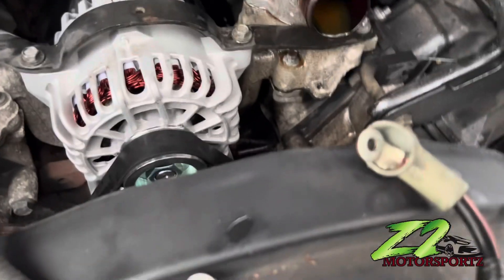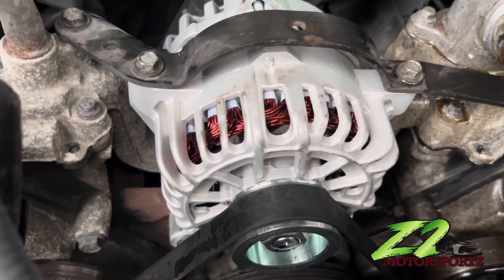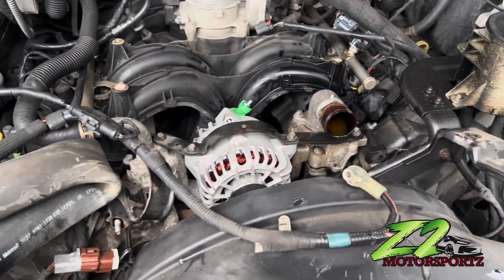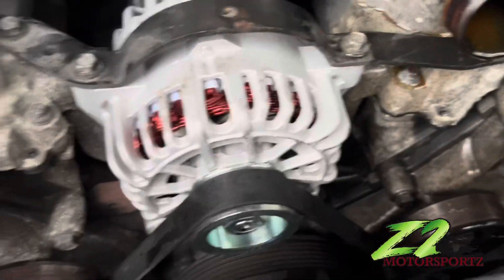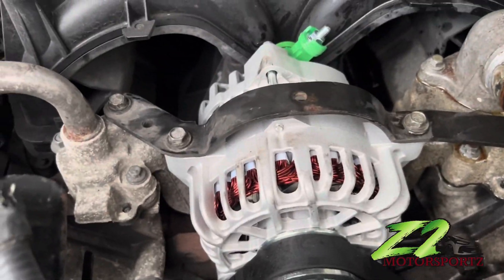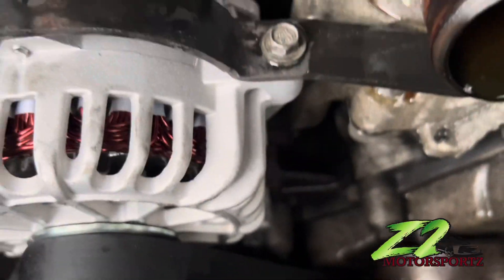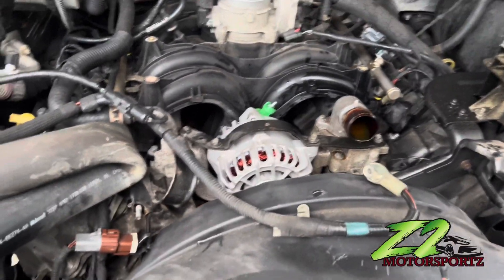We're back. I put the belt back on already, bolts are all tight — 10 mils, everything's back. Man, this alternator's got to be one of the easiest alternators I've done. I'm about to put the hose back on. Like I said, 10 millimeter bolts all the way around to do this job. You're gonna need a 13 to disconnect the battery, and you might need a 10 wrench to get to that side bolt, but besides that, that's it in a nutshell.